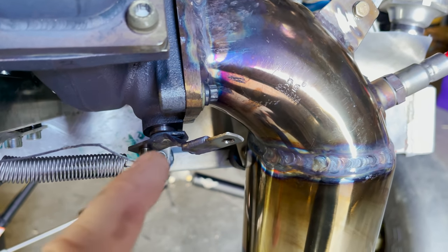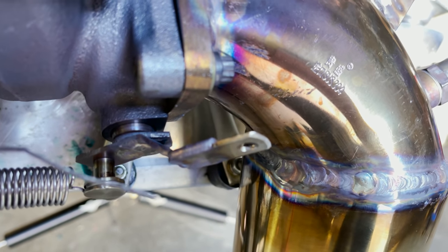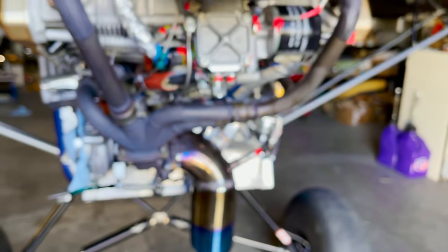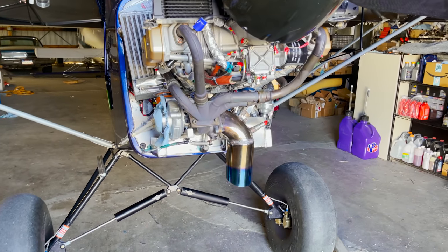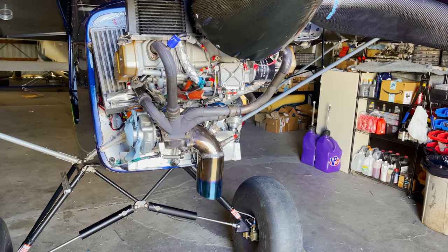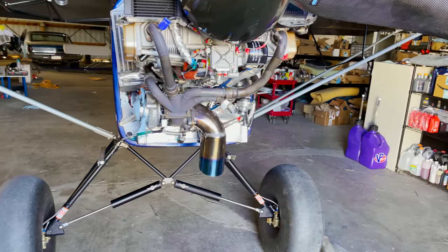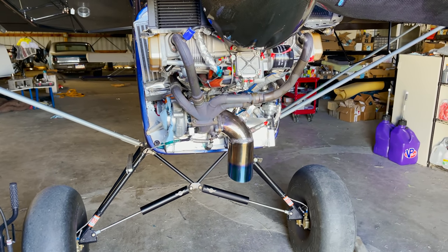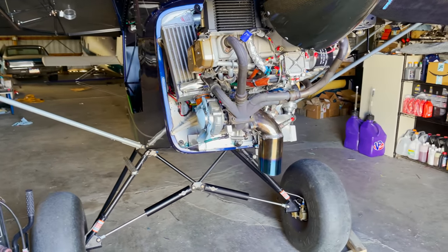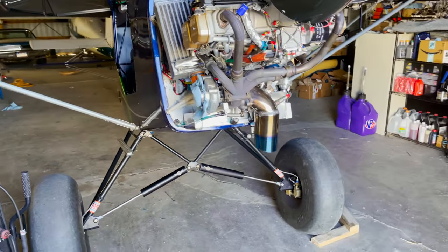I welded on an extension — I extended it out approximately 55%. That will give me the needed resolution on that servo that I was lacking and make it smoother so the boost isn't oscillating up and down. I'm going to mount it all back up, reset the servo to the right values, change all my tables, go about 60% to be on the safe side, and then ease into the throttle and see what we've got to tune from there.